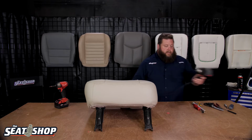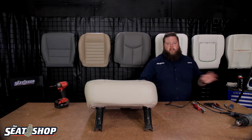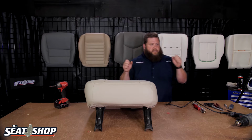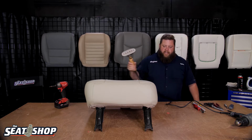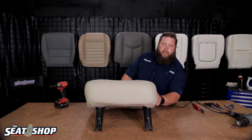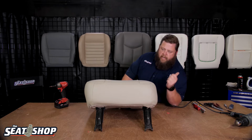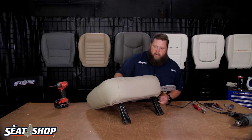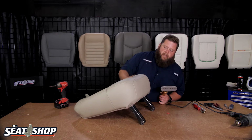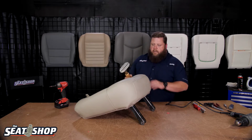Now with the heat gun on the carpet, on the sides and back, underneath and like that, don't get anywhere close to it with the heat gun. It'll instantly just singe up, and it's not good. So I always held my hand or arm to separate the carpet part when I have the heat gun out, because it'll singe it in 2 seconds. But we'll start with the steam, which won't bother it, and once this gets rocking, we'll start steaming this out.